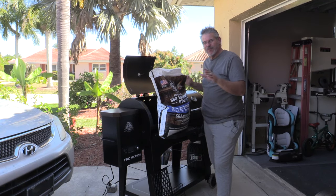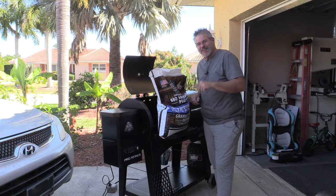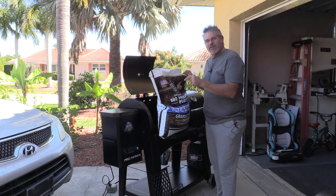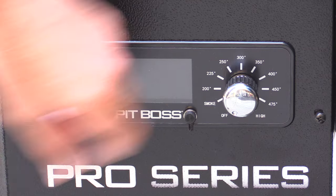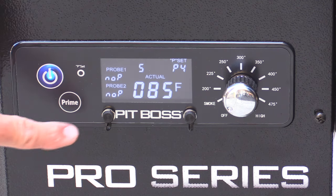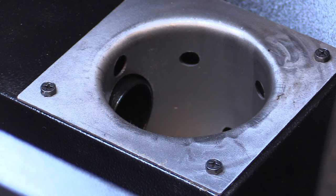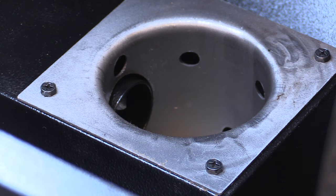I just want to burn it in and try it out here. So let's go ahead and move this aside and then we'll test it out. I'm going to go ahead and turn my power on and set this to smoke mode so that the element kicks on. And I'm going to show you down inside while I press this prime button, which will begin to move the auger. So I'm now pressing the prime button down, and if you look right above that heating element, right below my finger here, you can see the actual auger turning around slowly.